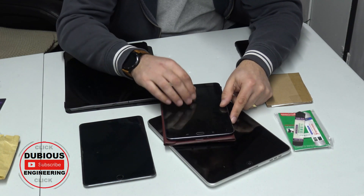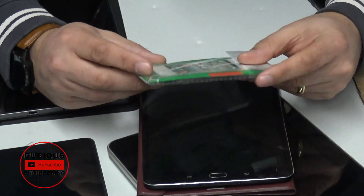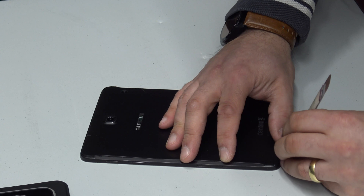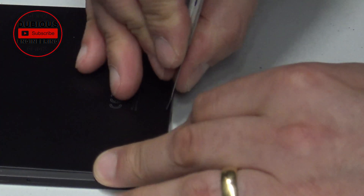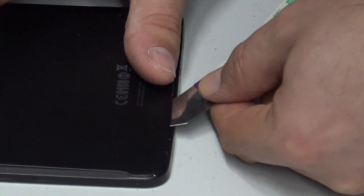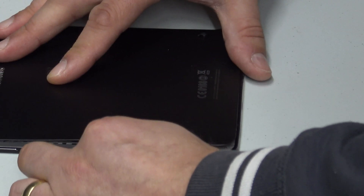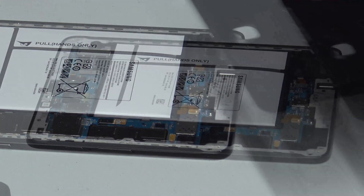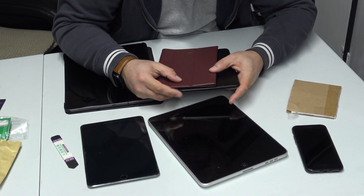Today's episode: replacing the battery in the Samsung Galaxy Tab. First thing you're going to need is a spudger — the big Clive spudger. Get that spudger in between the case back and the body housing, and with a little bit of luck figure out how... there we go. Once you've got a bit of that going you can effectively start to pop that off, and you just work your way all the way around the case.